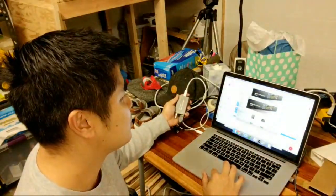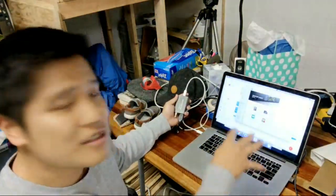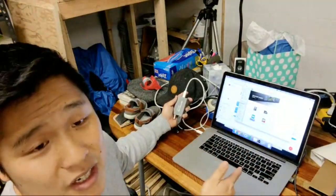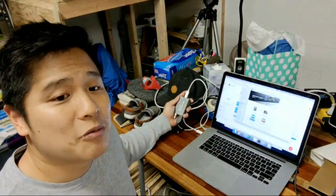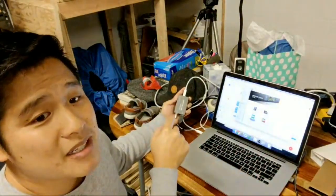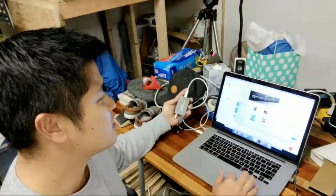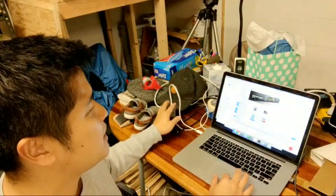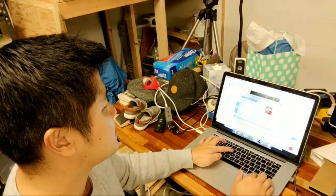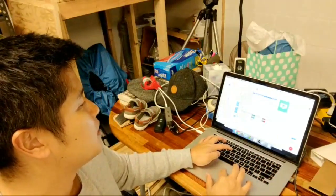You put the micro SD card in and you'll see four icons. One of these icons says 'Install Desktop Video.' That's the actual piece of software that runs and basically tells your computer, hey, there's this Blackmagic box and here's how to talk to it. So once you install it, which I already did, you're going to want to launch that — it's called Desktop Video Setup.